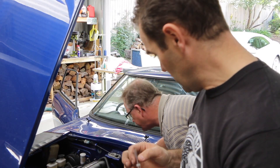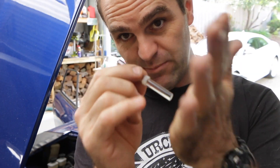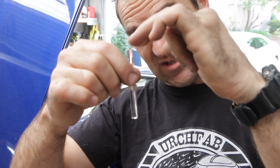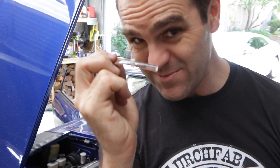We just went through and tested the float level heights using a tool that Graham got from a guy called Keith Franks from Side Draft Central. It's a simple little piece of clear acrylic, polished up. You take out a jet and slide it down through. As soon as the tip touches the petrol, you can see the color change through the top. It's got a little slide on it — you measure that distance, and that gives you the float bowl height. You can then check all the carbs at different heights. Very simple, very smart idea.